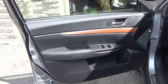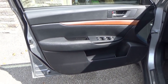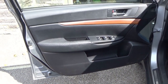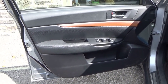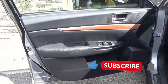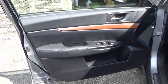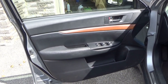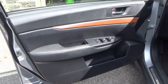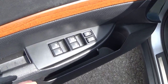I've watched several videos on the procedure of removing the electric window regulator, taking the door panel and such off. And they're all pretty good, except for one thing that I've noticed. A lot of them have put this door back together or tested it and found out they had the wrong motor in there, because there are 2 motors for these Subaru Outbacks, and around this year of 2012, 2011. I will put the full range of years that this covers down in the description, but I will show you the differences, and it'll save you some time and some mistakes.